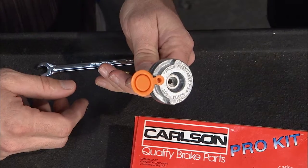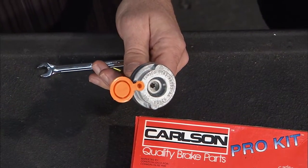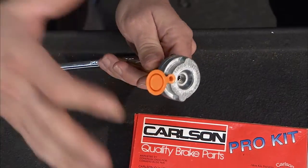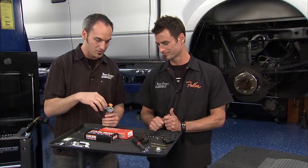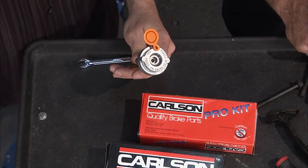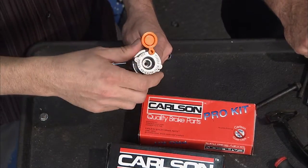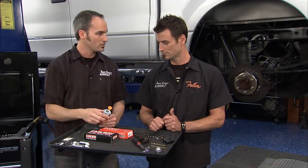It's amazing how picky we are today that even on a pickup, we're upset because there's just that little bit of vibration in the parking lot. What's cool is a lot of vehicles — European vehicles and even modern vehicles — are starting to come out with this technology. This is actually a factory Ford part going on the 2011 and 2012. There are a lot of vehicles that have them. Since this vehicle has the same caliper setup, we can retrofit it back and take care of another one of those little noise issues.